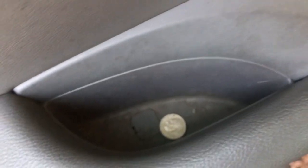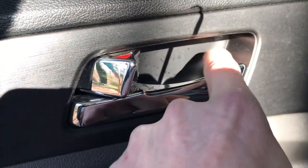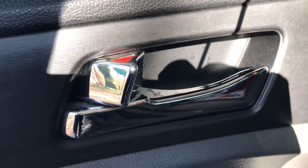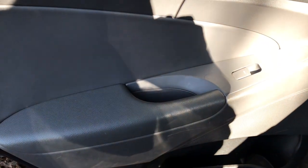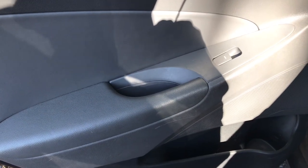Move slowly. There's a little panel in there. Use the metal pick again. There's a little cover behind the handle — I can get it out from the side. That looks to be the three screw access points. Usually you have a couple of screws and there are plastic clips all around the perimeter that pop out. If it's not coming and you're like, 'Did I miss something?' — maybe you did. Some of these plastic panel clips can be a little difficult to remove.